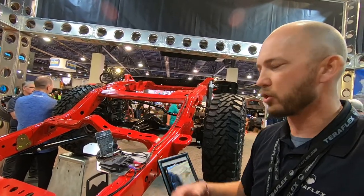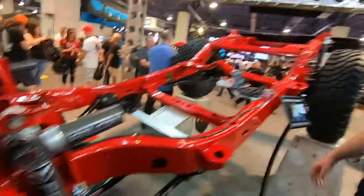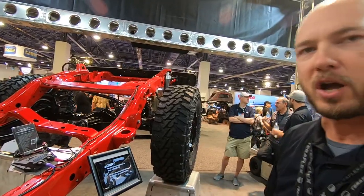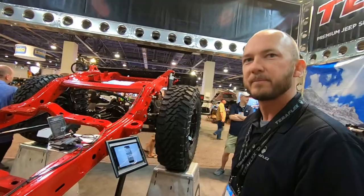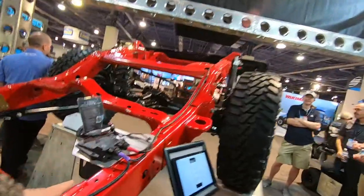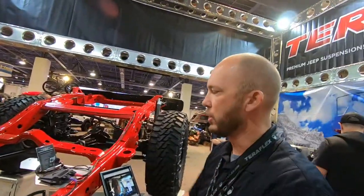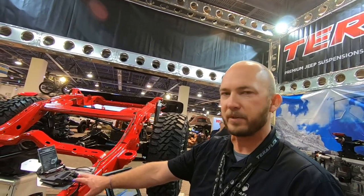How does that work? It's all controlled with the app. You do have some adjustment on the shock itself, but when you switch it into auto mode, it's automatically going to adjust the firmness of the shock depending on the g-forces that the vehicle experiences. So it's based off of g-force and how rough your ride is. And yes, if you've got the electronic shocks, you're going to be able to do E-Adjust with Adapt on any of our lift kits.